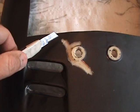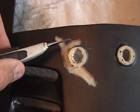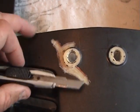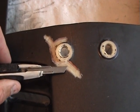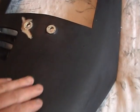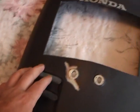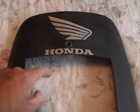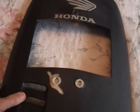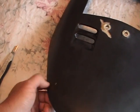I'm taking a Dremel and routing all the crack area — from here all the way down to here, around here and up to here. You have to go beyond the crack. I'm going to use JB Weld in there, then sand it smooth. I should use a plastic welder but I don't have one. The Hayabusa decal area — you can feel with your hands it's gone now, smooth. I've decided I'm just going to come down from here to here, leave this black, fix everything up, and paint all the rest purple. You can change your mind and have any kind of design you want.